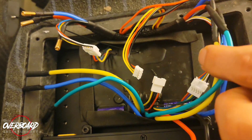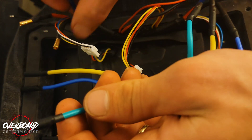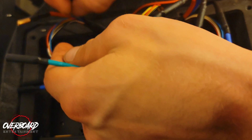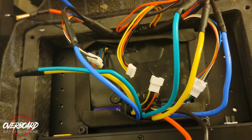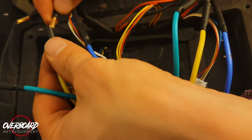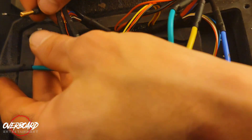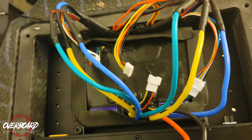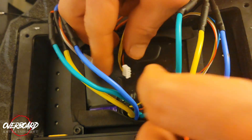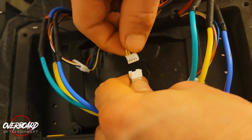Make sure you get your motor wires properly separated. You want to put your black motor wire into your blue ESC wire, then put your blue motor wire into your yellow ESC wire, and then get your red motor wire and put it into your green ESC wire. Then obviously repeat on the other side. The last thing is to connect this small connector — make sure it goes in the right direction.